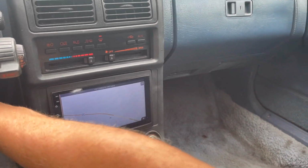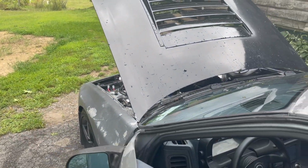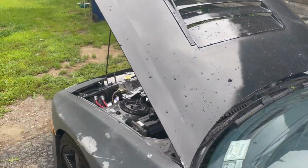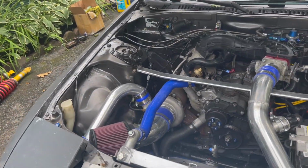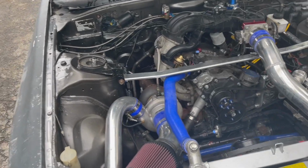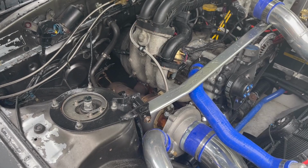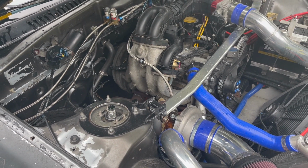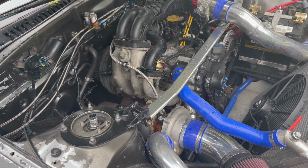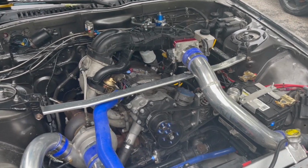These kits will be available pretty soon here. Turbo, non-turbo, whatever. I prefer turbo. Everybody has an issue with these Renesis motors with turbo. There's absolutely no issue if you tune it properly. If you got the RX8, it's been running like 15 pounds of boost on a Borg Warner 363 or 364 for like 3 years now. It doesn't care. It's a 100,000 mile motor.